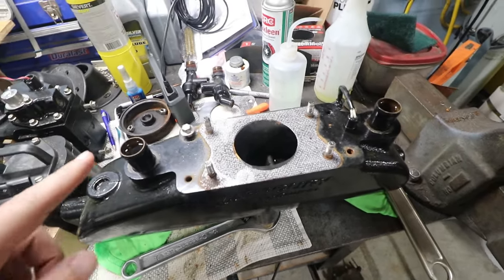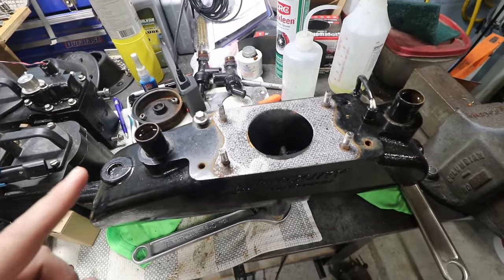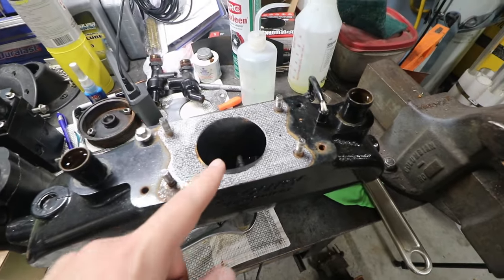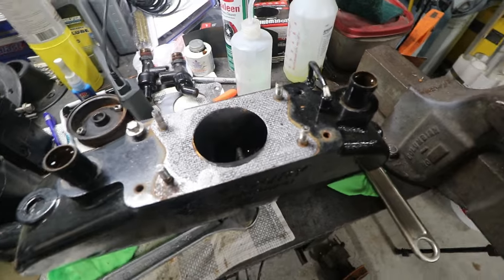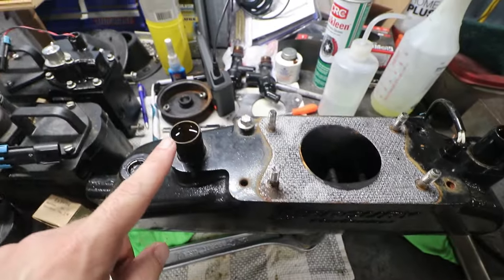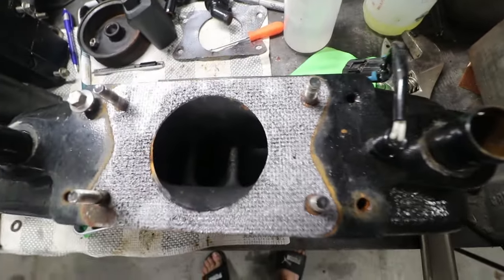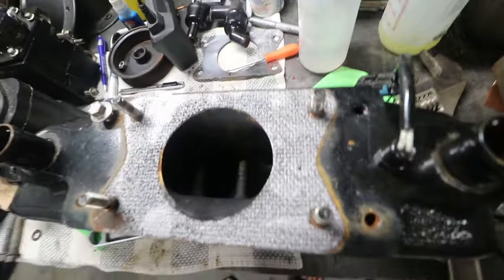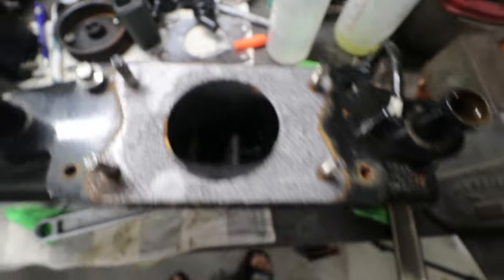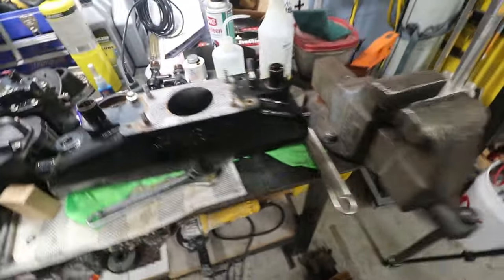So what we're really doing is checking to see if the acetone level drops, and then giving the ports an inspection as best we can — visually seeing what we can see. I actually have a borescope that I'll use to inspect down into the ports a little bit more. At this point I'm basically using the borescope as a flashlight to see with my actual eyes whatever I can see, and then we'll use it down in the ports. So far, so good.